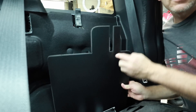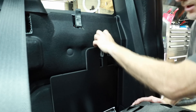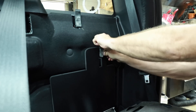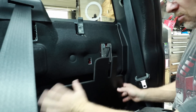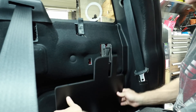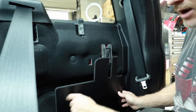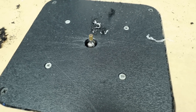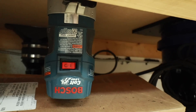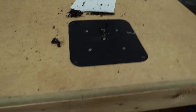And this is what we end up with. This is the groove I was talking about. To know where to drill the hole for the bolt, all you have to do is press really hard onto the material — it'll leave a mark on the back so we know where to drill. We went with the blown PVC Sintra. We always round off our edges on this using a small roundover bit from Mobile Solutions, connected to a Bosch micro router, positioned in front of our vacuum so when we're done we can just brush it all into the trash.